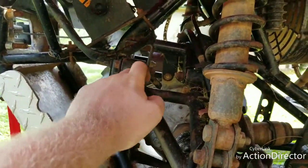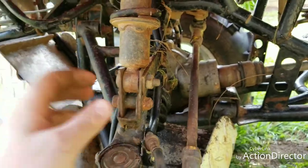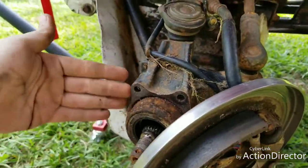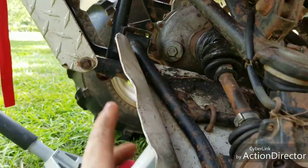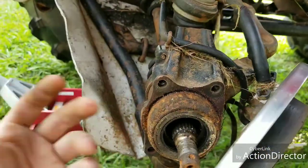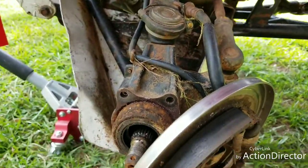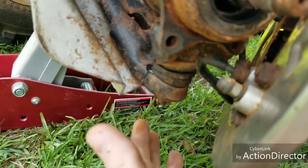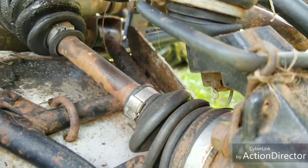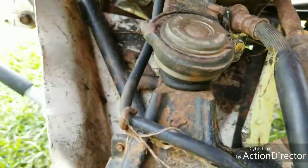To remove the ball joints, take the bolts out of your upper A-arms - probably remove the top bolt since there's a bracket there. The shock will come loose, this piece comes loose, and then you can flip it into a weird position. You have to loosen the lower A-arms too, then this thing will swivel and the axle pulls straight out. I have an actual press to press them out if they don't want to come, though it may be tricky to use in this position.